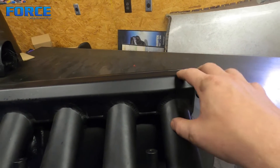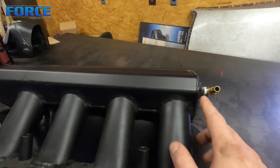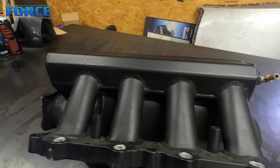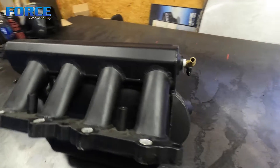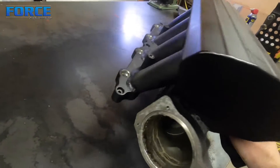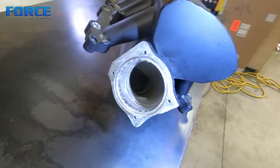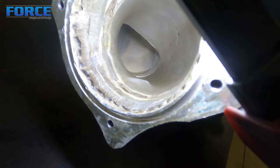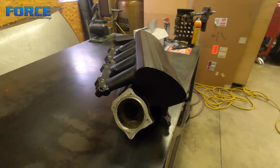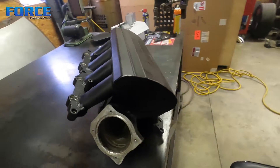In here there's a velocity stack in the plenum, and you want to provide the same amount of air around that velocity stack ideally on all eight cylinders. The front one has a much larger air supply to pull from than the back one. That said, I don't see any real distribution issues across the cylinders, and I think that has a lot to do with the air being center-fed by the length of the intercooler. Also, on the throttle body, there's a little lip at the bottom — I'm going to try to hand-port that out a little bit.